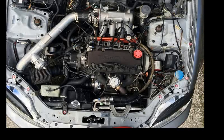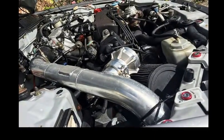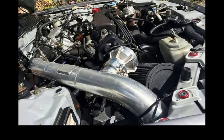I just wanted to talk about that amazing single cam build: stock head, Vitara pistons, cheap $200 H beams, out there putting work down. Anybody wants another one, hit me up. I got some drill bits now that cut through the block like it's all good. So I went from 8 hours of labor to notch the block down to an hour. So I'm definitely gonna be putting out more of these from now on.